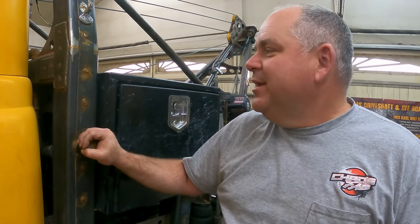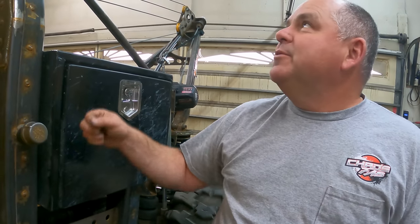So Tyson decided to run home, grab some Romex. That'll be the Goldilocks answer for this whole thing. It'll be stiff enough to push past here, but flexible enough that we can run our fingers up in here and pull that back out, and then we'll be able to pull these wires back down through this too.